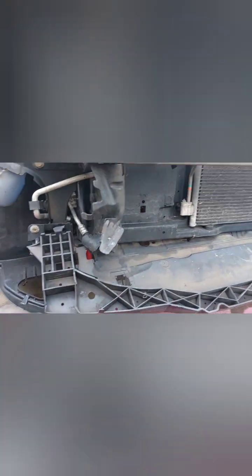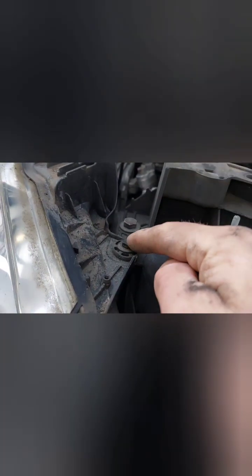Now, as I mentioned earlier, this is the process to get headlights off, because headlights got one bolt up there. There's another bolt here that you can't access until you take a bumper off. And I think there was something underneath, if I remember rightly. I just can't see anything there now. I think there was something, but hey ho, can't see it now. Anyway, for that bolt there, to remove the headlight, you definitely need to take a bumper off.